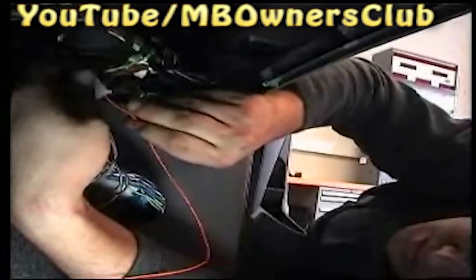The cable is moved further up. Open the protective bag with suitable tools — this is fixed with a cable tie. Separate the plug of the stationary heating and connect the cable in pin number 4. Afterwards, fit the connections together again and stow everything well-protected in the bag. Close the bag with a cable tie.